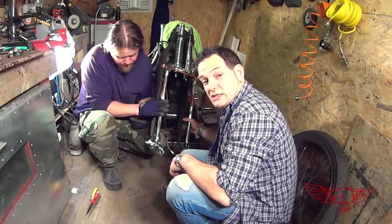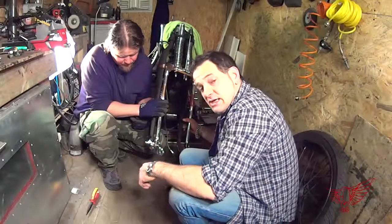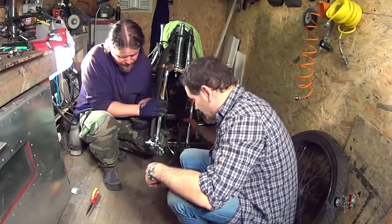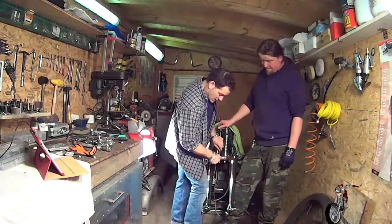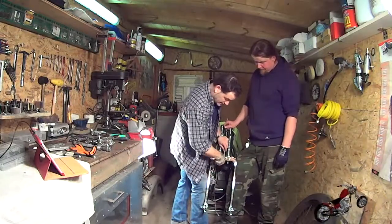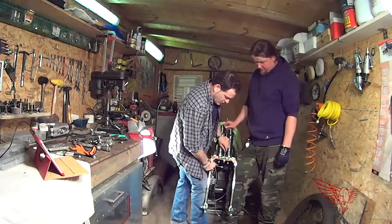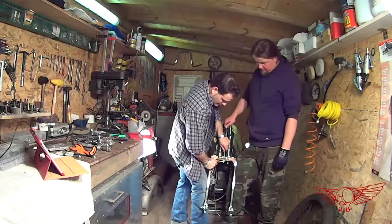Remember to push in the other side while you're assembling this side so everything aligns nice. Get a wrench, start tightening up. We'll proceed with the other side. Now that we have mounted the rocker arms, we can uncompress the spring compressor and release the springs to support the front Springer assembly on their own. All it takes is spinning this bolt.